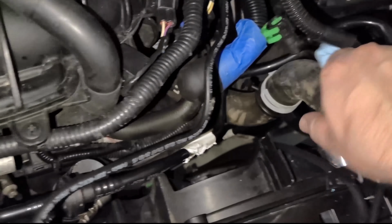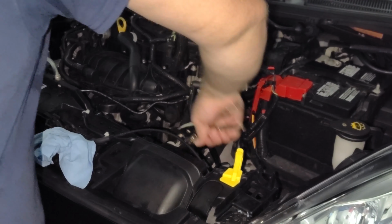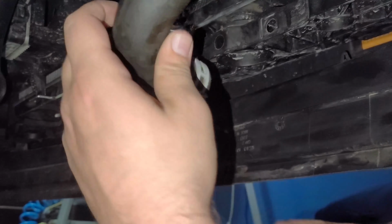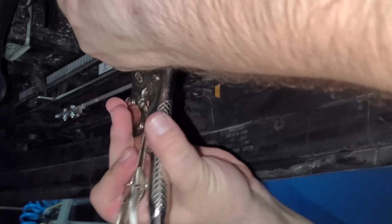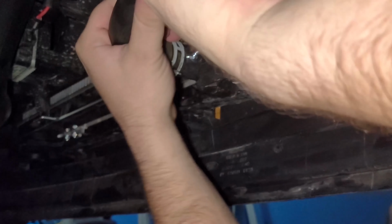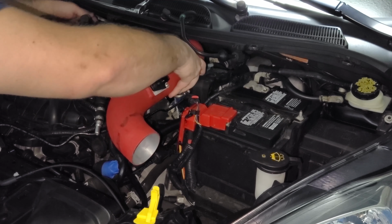Clean the upper radiator hose, coat the inside with new fluid, and then reinstall as shown. Then, perform the same procedure with the lower radiator hose. Now go ahead and reinstall the intake system, vacuum lines, connectors, mounting nut, and the hose clamps.